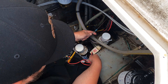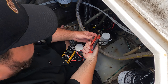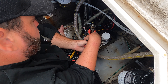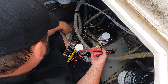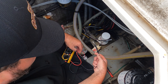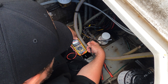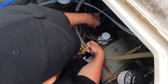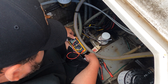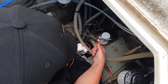There's a power lead coming in and a power lead going to the pump. We're gonna cut a little bit of this back just so we can get a good reading, and we'll heat shrink everything when we're done. We just want to make sure we've got power. Here's my negative and there's my meter positive — we got good voltage. Since we've got good power, it's either the float switch or the pump. We've eliminated the power problem.